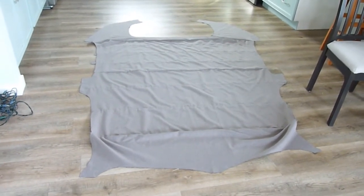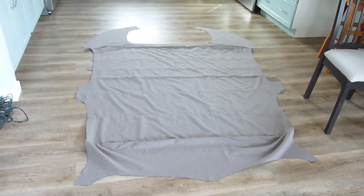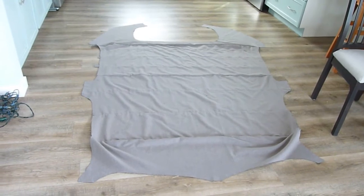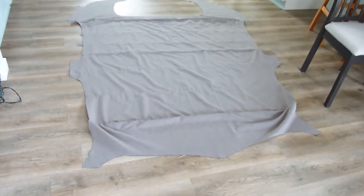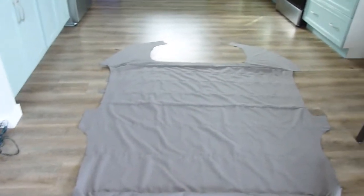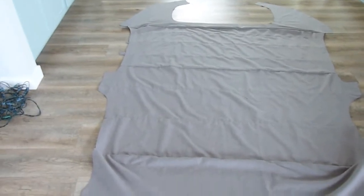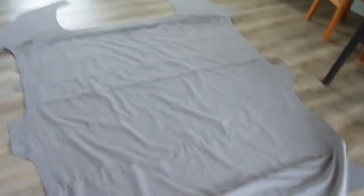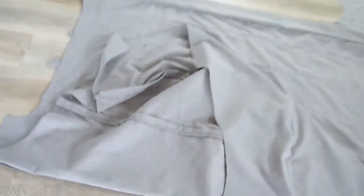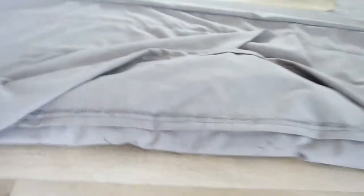One headliner — looks good. Will it fit? No idea. I tried to be as careful as I could, but I have no idea what I'm doing so that may not mean anything. It does have a natural bend to it — the corners where the roof line changes, it does curve through the middle. It's just a case of whether I got the hoops in the right places. All the hoops are behind, all the way down — eight of them.